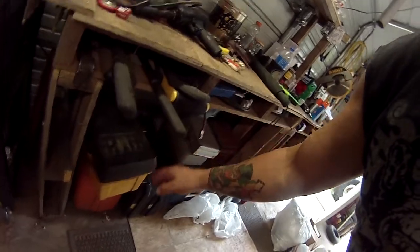And Coca-Cola. I just poured that Coca-Cola on there and the steel wool and just start going to town. The steel wool does not scratch the foam or the chrome because it's really super fine, and the Coca-Cola with the acids and any other junk that's in that bottle eats away at that and cleans it. And then after I did that, I polished it, and I didn't use a chrome polish. I actually just used Meguiar's paint cleaner polish. It's kind of like paint cleaner and polish together in one bottle for them touch-ups or whatever.